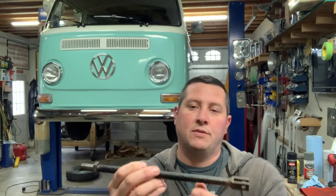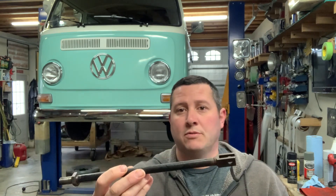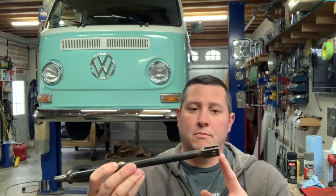I ran into one very helpful thing. Kind of just scavenging around — all the parts for this conversion are available new except for one piece: from the brake pedal assembly to the actual new booster there is a rod, a push rod, whatever you want to call it, and that's the only thing I cannot find new. These are very hard to find, so yesterday this finally came in. I screwed it in — threads are correct. This is some M14 or something; I don't have the die to tell exactly what it is, definitely a metric fine thread.